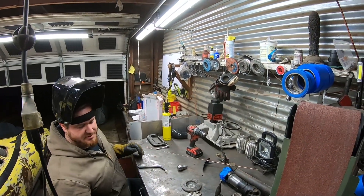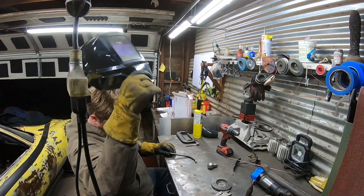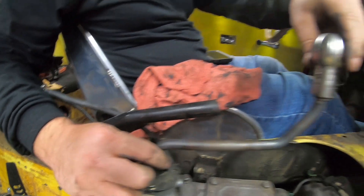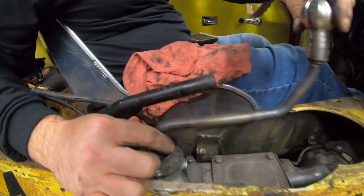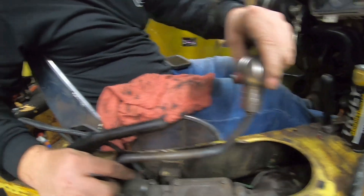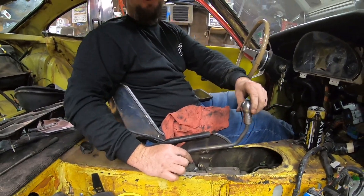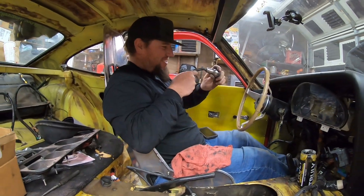There you go — now she's got threads. Pull that off and throw the shifter on there to see what that looks like. So that's the final shape. A little bit wonky, it does seem strange, but it makes up for the large deficit of space between here and here. And it's pretty ergonomic considering he sits much further forward than I do in my car. I have room too. So we'll go ahead and get that tacked and weld it up and see how it looks.